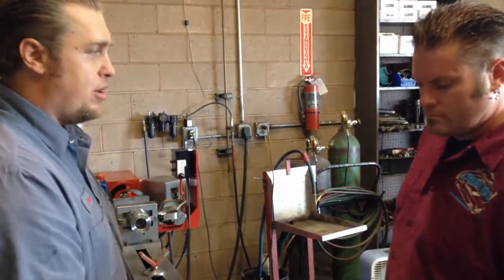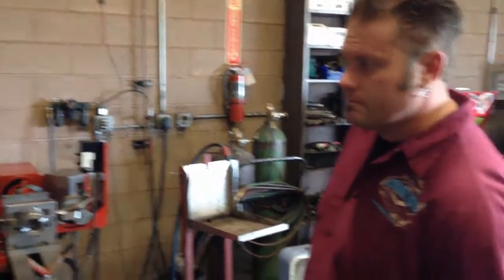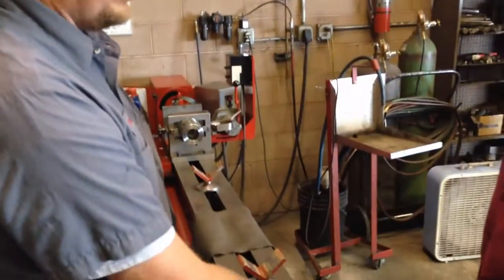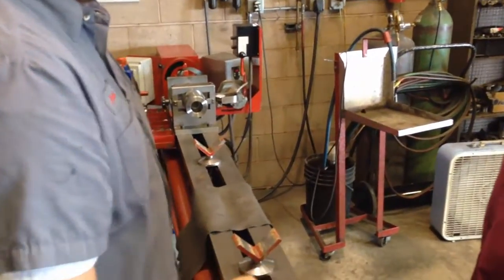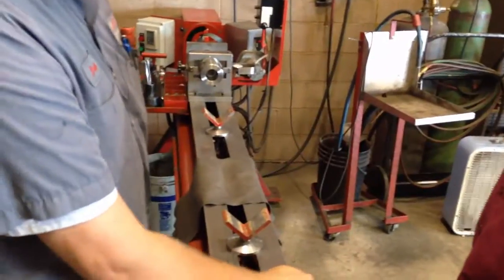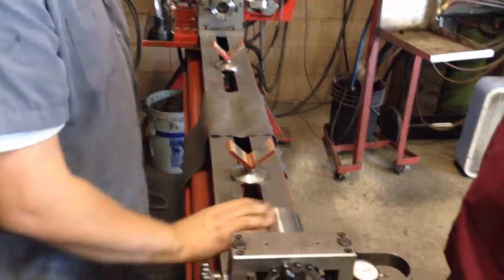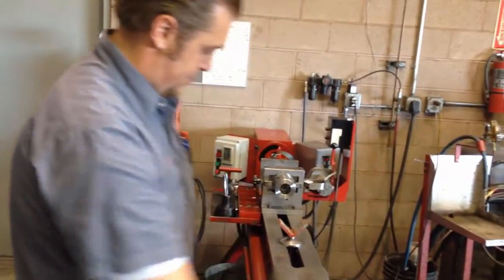Something that's a race car that has like a 513 rear gear, you have a lot faster driveline speeds. And this won't necessarily tell us what it's doing at 6,000 RPM, but typically if you have a shaft that's smooth up through 3,300, if you've got a problem, you already have it at that speed, and you won't need to spin it much faster.